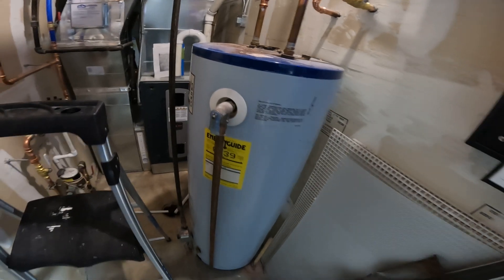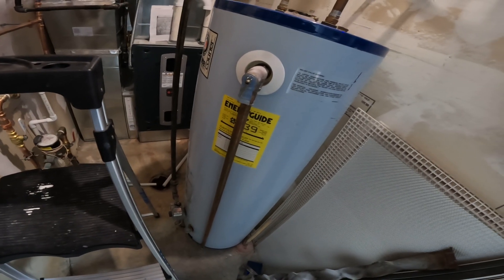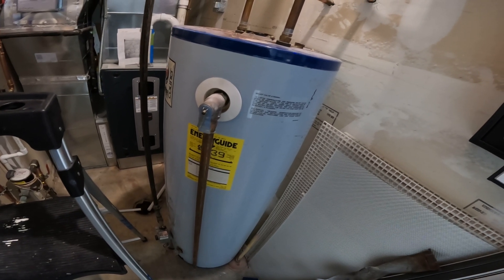It was really windy a couple days ago and the pilot light went out. So I re-lit the pilot light and turned the burner on, but the gas was not going up to the burner correctly. I pulled the burner completely apart yesterday, cleaned out the orifice, vacuumed out the bottom of the pan, cleaned off the thermocouple — just made sure everything was clean so the gas would flow. Put it back together and the same thing happened: gas was not evenly going through the burner, and flame was kicking out the front of the door.